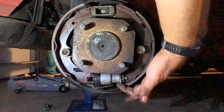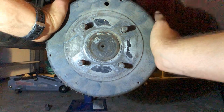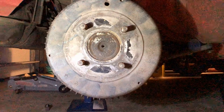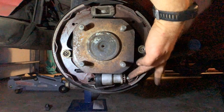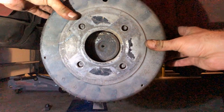One of the last things to do — built into this drum cylinder is a self-adjusting handbrake. I haven't bled the brakes but everything's connected. I've completely put together the other side, so what I'm going to do now is go yank on the handbrake a few times and you should hear click, click, click — that will slowly adjust the drum brakes out. Might be more than just a handful of clicks. When you pull this off you should see that the adjuster nut has come out a bit further. When it stops making clicking noises when you pull the handbrake, it means these drums are adjusted. So now these are all ready for bleeding.